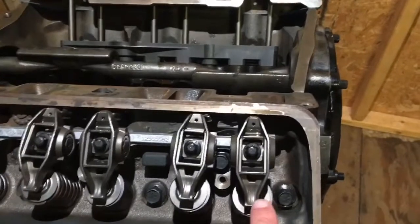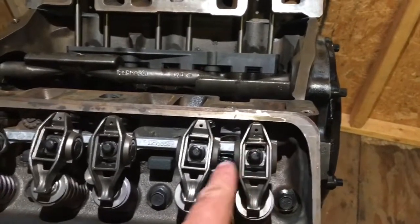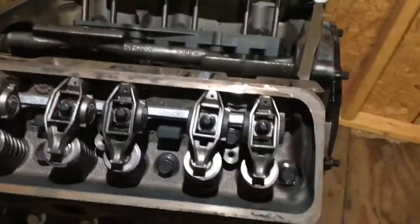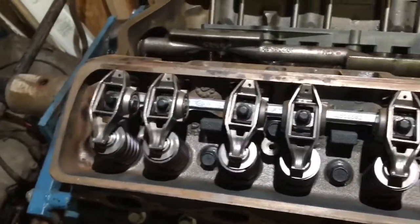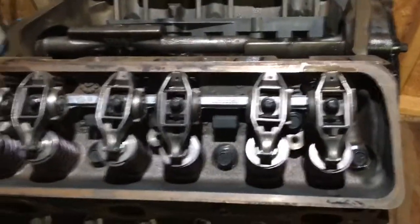You oil under the rocker and on the roller bearings on either side, then put blue Loctite on these bolts. I don't think Loctite was strictly necessary — these may be friction bolts — but the blue Loctite won't hurt. That's one side done. I'm going to do the other side now but I'm not going to video that because it's identical to this side.